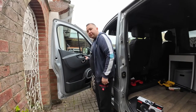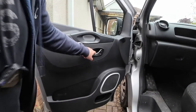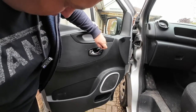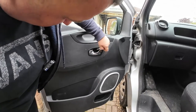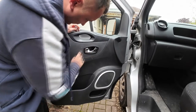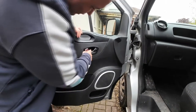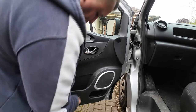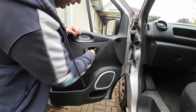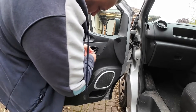I'm going to get them screws off now. On this screw here there's actually a little cap — you want to get yourself a little electrical terminal screwdriver, there's a little slot at the top, and just push that back. That screw in there is actually a T27 as well, so it looks like the outer ones could be T20s and the main two big ones that are pulling into the main door are probably T27.